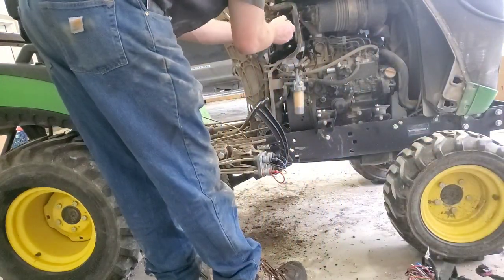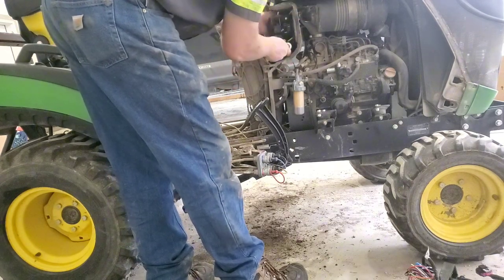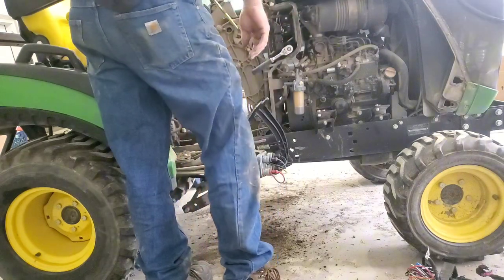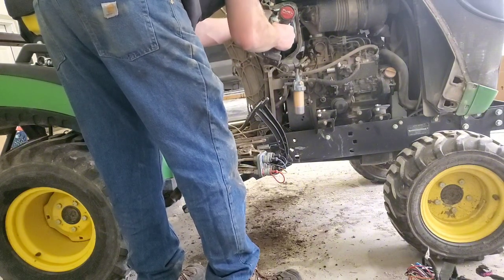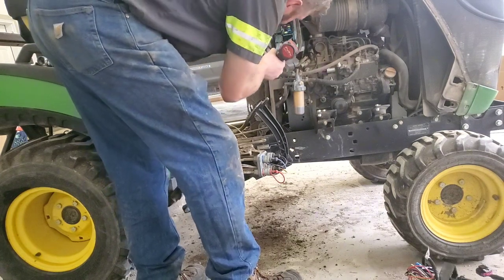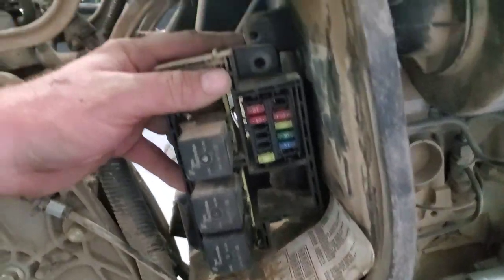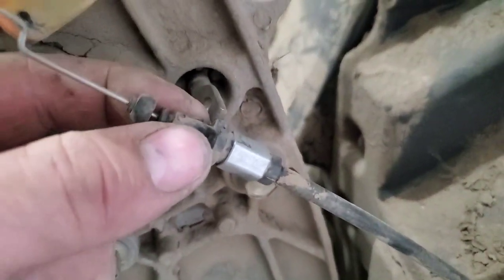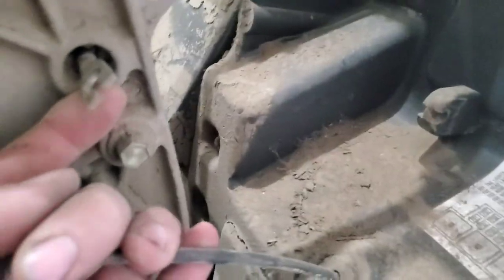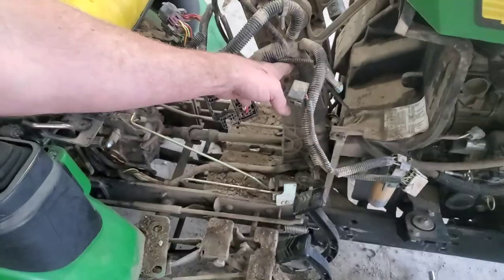A little progress here — I'm removing the fuse panel. Just before this, I got all the dash plugs undone, which is about three plugs. They have a little safety latch that you'll have to undo. Going ahead getting this loosened up — you'll get the fuse panel out, dash off, and start unsecuring from some of the places it's pinned into. The new harness comes with new clamps so you can pull everything out. We have the dash unhooked, starter and all that stuff — everything to the front console out. We took our little throttle cable off. You pinch it down and pull it below so you can slip the wire out.